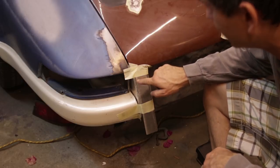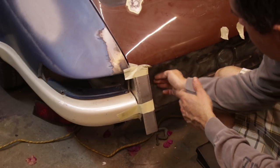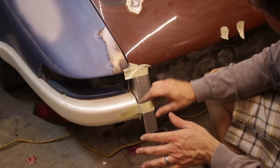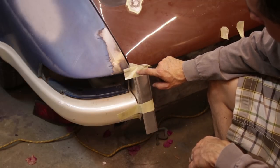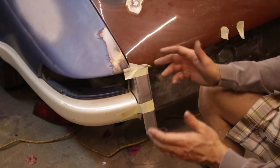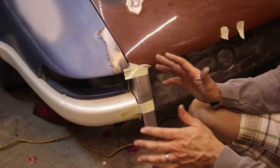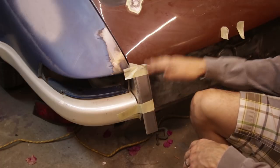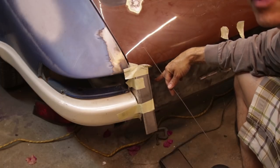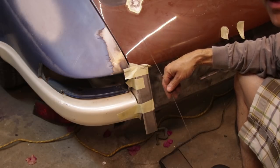I have this very precariously taped in place with the angles matching up with the bumper and the angle relative to the license plate panel approximately where I want it - flush with the deck lid. This piece which is about to be tacked in place is just hanging on with tape. The challenge now is to get a couple tacks on this so I can take it off the car and try to finish welding it without it moving too much. It's going to be a little awkward. With all this tape and the way it's connected to the license plate panel, I cannot get a good ground on this. So I have to reevaluate how to get this so the welder will work.